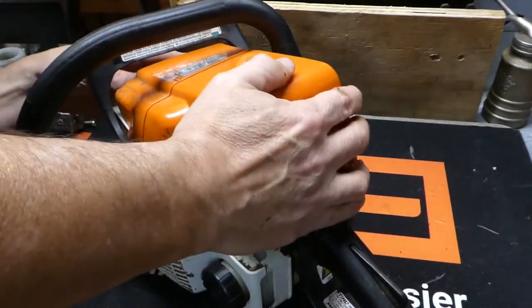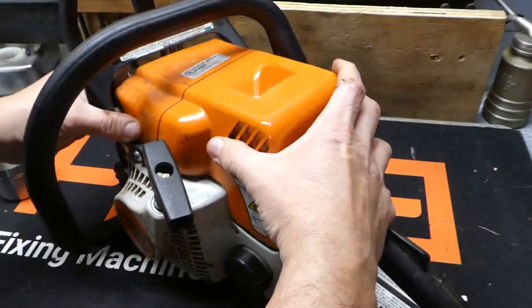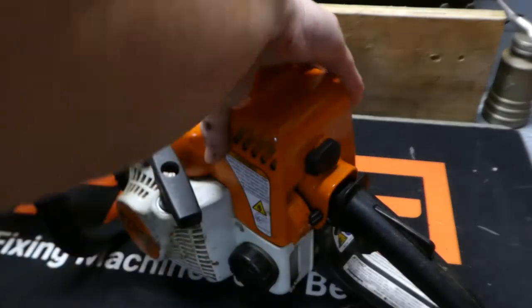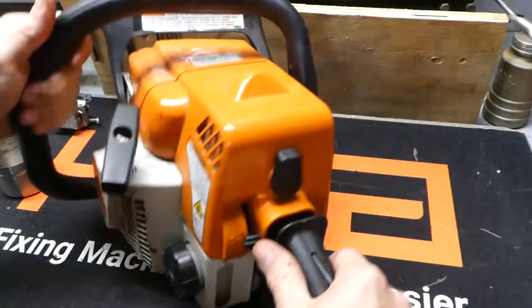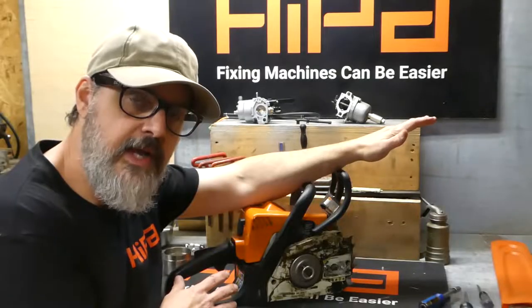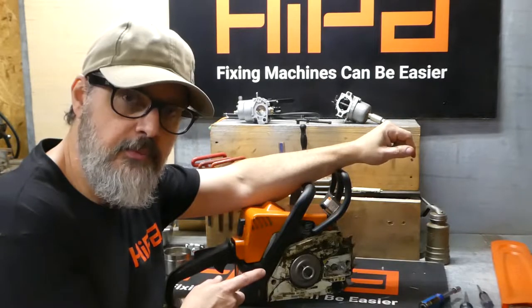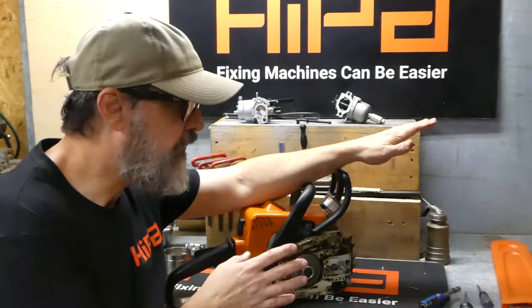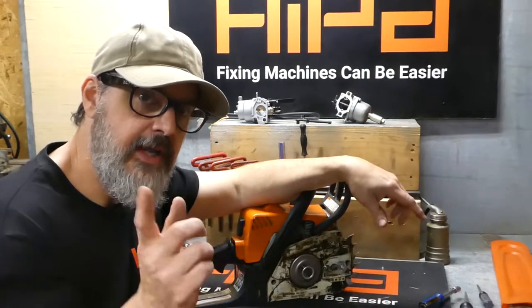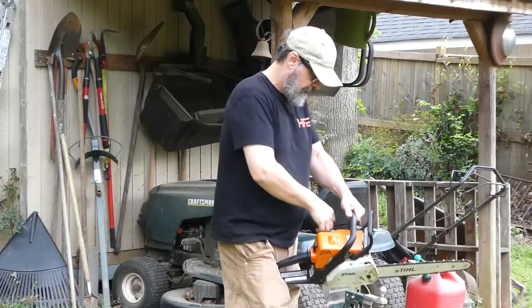Give it a pull, make sure we're all copacetic, and we can put our cap back on. Caps are a little annoying sometimes — I often have problems getting especially this side lined up the way it's supposed to be. Looks like we got it on that time. Alright guys, we're all buttoned up now. I'm going to put the bar back on and take it outside and give it a little bit of a run test. If you haven't seen our previous video on the Hyper brand chainsaw chains, I've been using this one for a while now and it's working great. I'll put a link in the description and also try to put a link in the cards and at the end of the video. Let's go take this out and give it a test run.